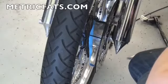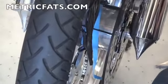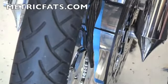Okay, so now we've soldered all our connections, and then what we did is we took shrink tubing and covered each group independently. In other words, the positives with one piece of shrink tube and the negatives with another. Then we put them together and covered both of them together with another piece of shrink tube.